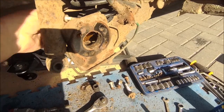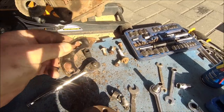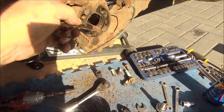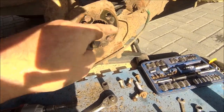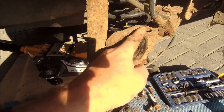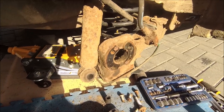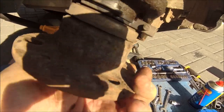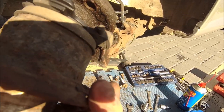Not as bad as I was expecting. The bolts were a little groggy but they came out okay. That looks like part of the old tin protector at the back - could be shims - actually I think that's part of the old dust protector. I've got some new ones coming so I am going to replace them. I was told you can leave them off but I like to do things properly. And there is the hub - and there is the problem just there: that wire been cut.